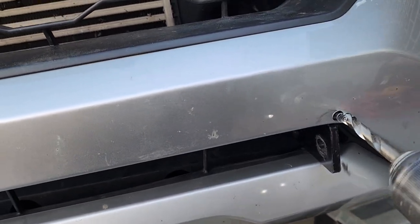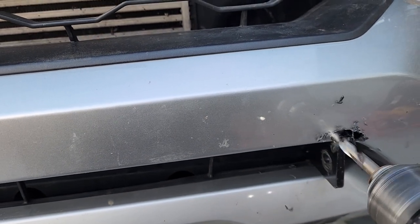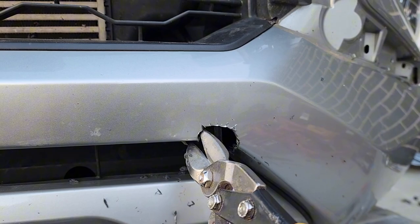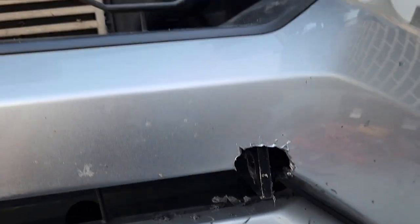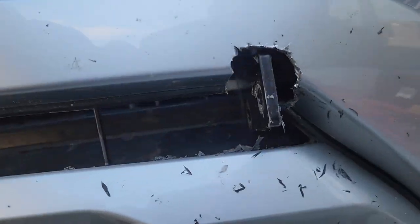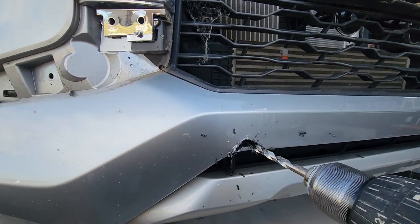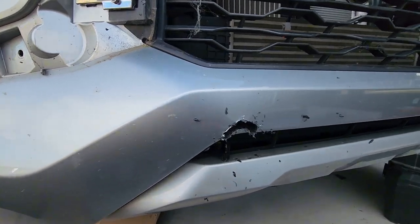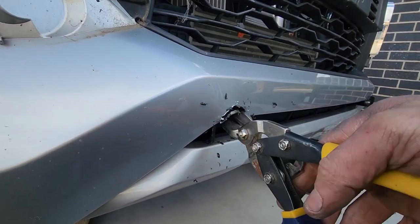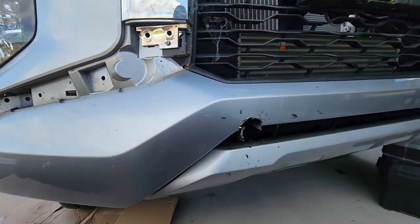A bit experimental — I've got an 8mm drill bit and I'm going to drill it and see what that does. The actual instructions say to use a 30mm drill bit and cut out quite a large section, which you still might have to do depending on how the bumper sits. I actually just used tin snips and cut through there on both sides, cut a little bit more off the top, and we are now in the right spot.